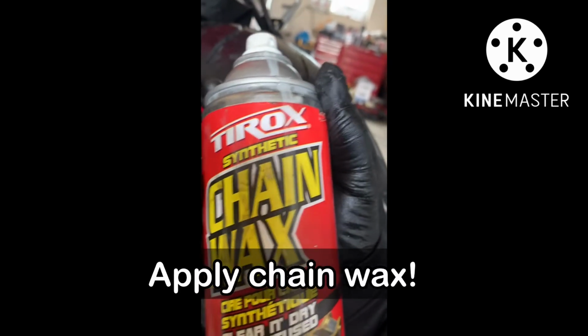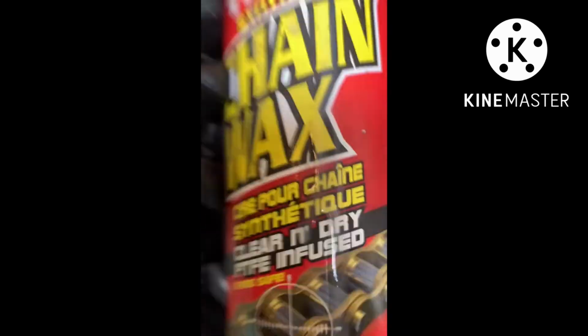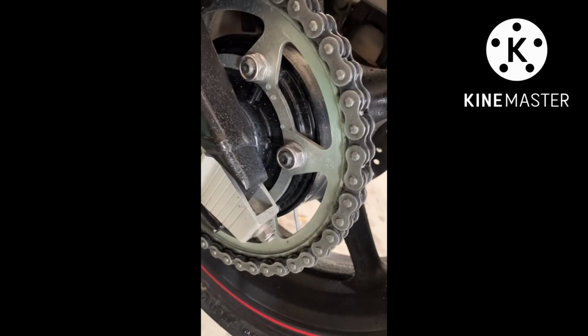So clean, chain clean. Now what I'm doing is I'm using a chain wax, as I said earlier. I'm not sponsored by this brand, but you can get anything, or maybe you can sponsor me later on. I'm using it. See there, that's chain wax. So you lube the chain accordingly. That's a good amount. That's it. Cool. See, my sprockets are clean. There we go.